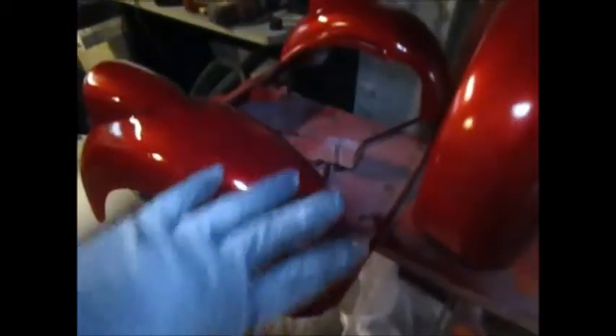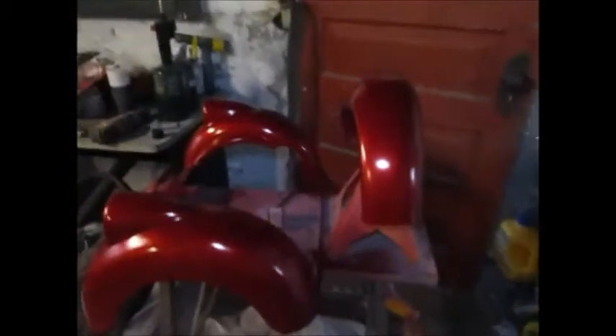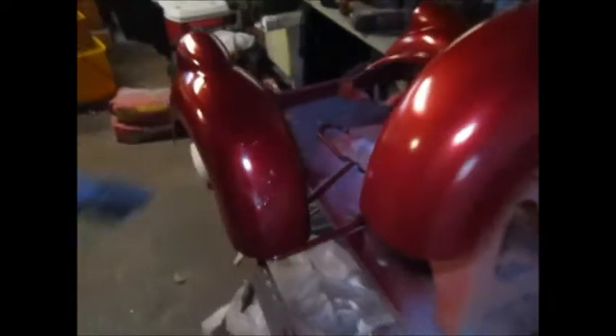I'm going to sand that one again. Even though that's the first coat, all the other stuff is good. What I'm going to do is hit it with 600 grit - sand the whole thing again with 600 grit. The primer is already there, there's some paint there. I'm going to keep respraying this window right now - that's going to be 10 minutes, 10 minutes, and then gloss. This is why I never paint when it's raining.